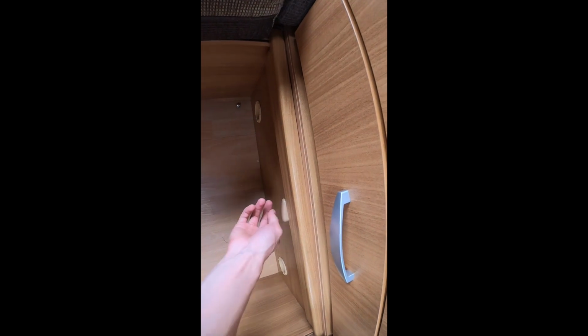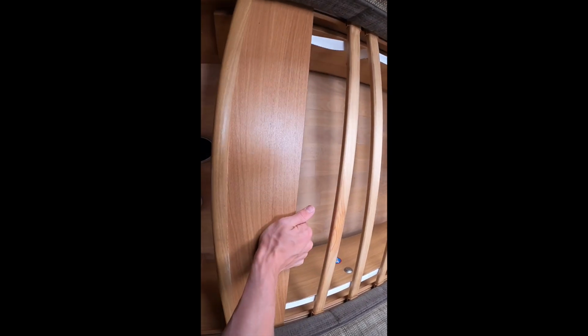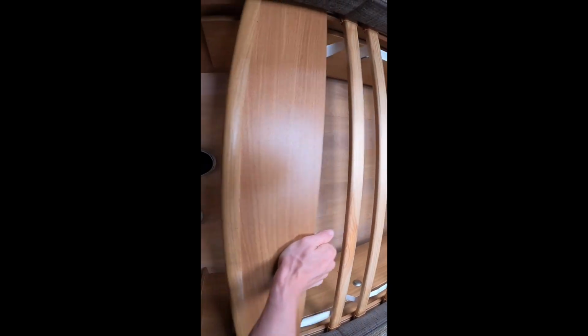And to make the bed in the rear lounge, you turn the turnbuckle, slide your latch system out, pull it all the way, and it'll stop on these grooves. So what you need to do is lift it up and pull it back and put it over the grooves, and that's pulled the bed lats out to the full extent.